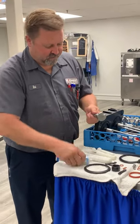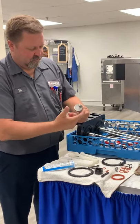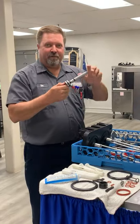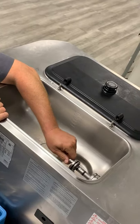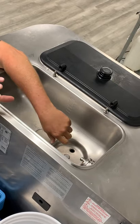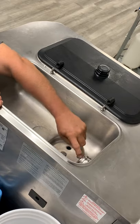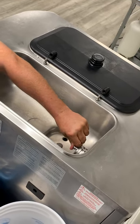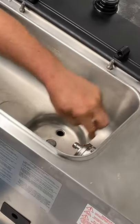Do a little bit of lube on the outer one as well, and we're going to put that in its place up under the hopper. Now we're going to put the drive shaft in place — just push it in there. You might have to twist it a little bit until the hex head finds its home. It may look like it's sticking out a little bit, but that's exactly the way it should be. Make sure it's pushed in as far as you can get it.